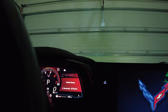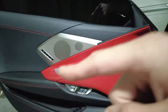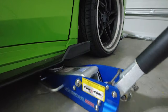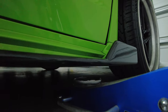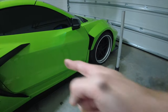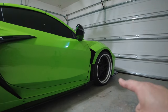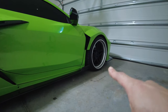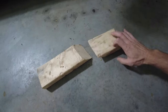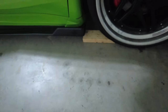Car is up. We're gonna open the door — shut the car off and leave the door open, because if the door gets shut the car will go back down. Now over on the passenger side we'll see a lot more clearance, but the puck is pretty far in there and the side skirts protrude out too far and end up hitting the jack. The game plan is to roll the front wheels up on some two-by-fours, then jack up the rear so we can check out that shock. This is what I did last time — I took a two-by-four, cut it in half, and made myself little ramps. We'll slide these back behind the wheels and get them to come up those one to two inches.